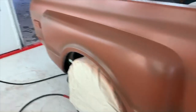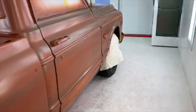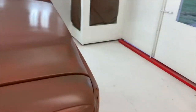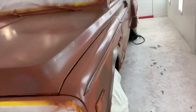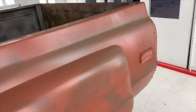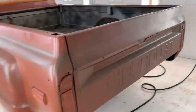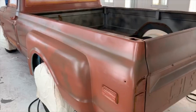It looks like rust, kind of like acid burning into the surface. It looks pretty good — it looks real airbrushed right now just because I was hitting it with a rattle can. But once I come back through with the white, I'll white-wash the whole thing, lay water down where I want my rust to come through, hit it with the white, then dab it all down. I'll probably yellow-tint the white and come back through so when I wet-sand it with 1500 grit, you'll see the rust coming through. I'm shooting from the hip here, but so far it's looking like an old beat-up truck, so we're on point.